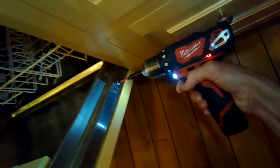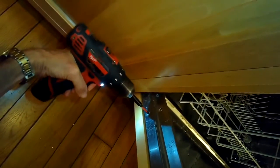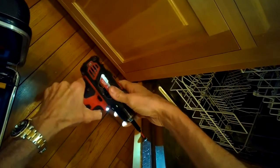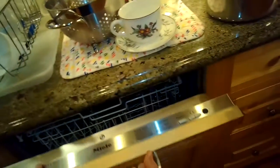I'm going to take off the cabinet cover first by loosening these 4 screws. Actually, we don't remove them, we're just going to spin them lefty-loosey, and that releases some clips that will allow me to lift up on the wooden cabinet facade and pull it off of the door. So this is on the Incognito model and a couple other models. Pretty cool, just blends in with the cabinet. So you grab it, after you loosen it, lift it up, it'll come right off.